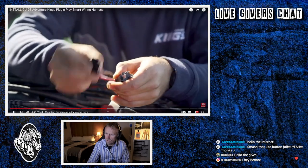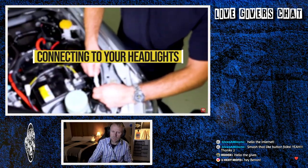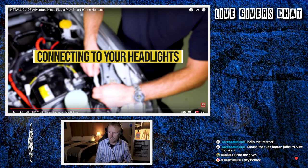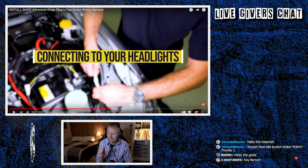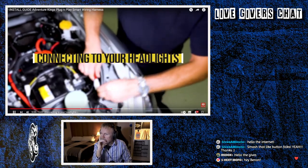You're left with these two black plugs. Unplug one of your headlights and these are going to run in between. So you connect that into the plug you just removed and that goes into the back of the headlight globe. Yeah, okay. So for a complete noob like me, you don't need to do it to the two lights. It's just sending the signal is what you need. So it's just cutting into the signal.